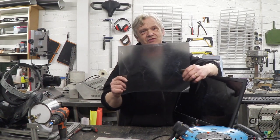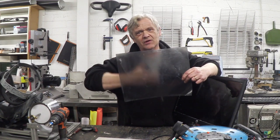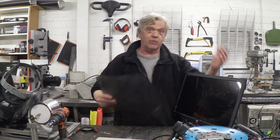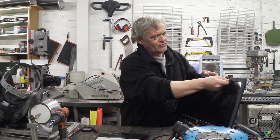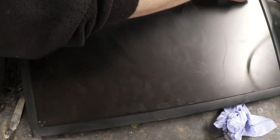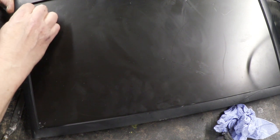What you need to do is take that piece off. It'll come off — sometimes it comes off as one whole piece. This is a bit of polarization film and you can see I'm kind of grey behind it because that light is now in a grid and we're only getting a bit of it through. To get that off, it is a little bit challenging. You need to go around the edge with a knife — not too sharply or you'll break the glass underneath, just enough to score the plastic. Then get something under there to lever it off. Just run around those edges lightly, then start at one corner until you can get it under there.